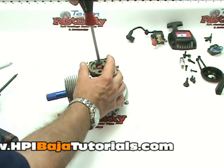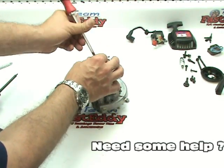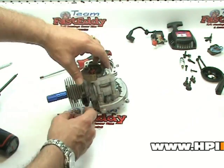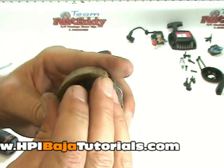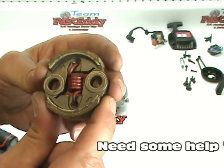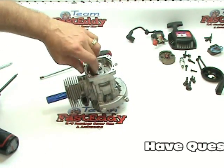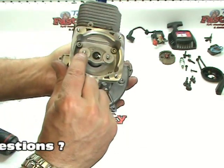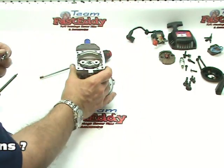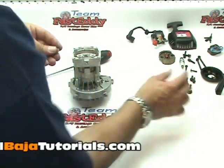Let's go ahead and remove both bolts. At this point we can go ahead and lift the clutch assembly off — it comes off in one piece and it's going to look just like this. You're also going to want to inspect your clutch for wear, and if it's worn unevenly or shows an excessive amount of wear, you're going to want to go ahead and replace your clutch pads. Inside, as you have taken off your clutch, there are also two washers — one that goes under here and one that goes under here — and you want to make sure that you don't lose those. We're going to slide them right over the clutch bolts just to keep them in one spot so we know where they are.